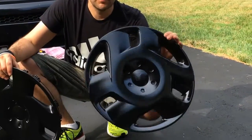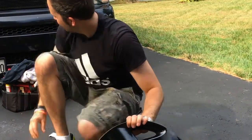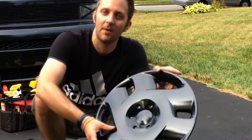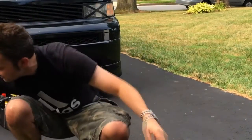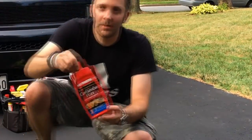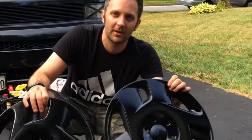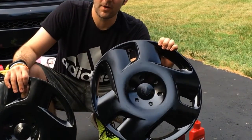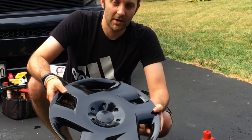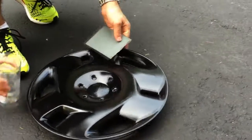Here's the before and after of what we're trying to do. We've got the black with clear coat on top, and now we're going to shine it up using wet sanding. Take some 2000 grit sandpaper and water — you have to do it wet — and we're basically going to rough up all the paint we did, then buff it back using three or four coats of polish with a lot of elbow grease, then put some carnauba wax on top — maybe two coats.